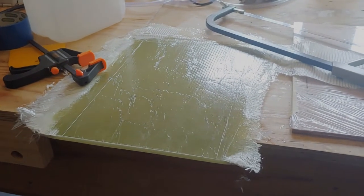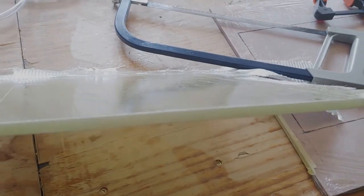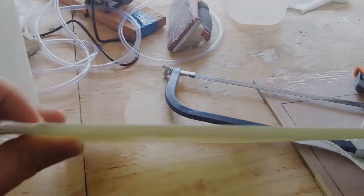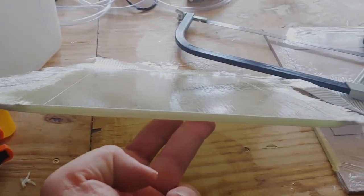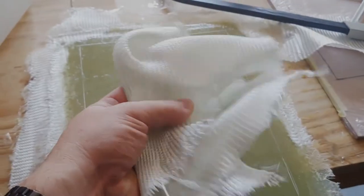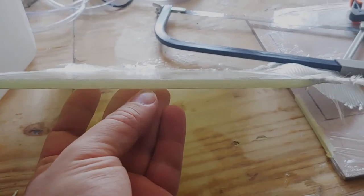So today is the next day. Last night first my power went off and then I had to work by lamplight, and then eventually my phone died while I was recording. The lighting here is not the best. These are landing gear hardpoints. I thought at the time it was a disastrous layup, but it's come out pretty well - it's come out exactly a quarter inch, which I'm happy with. Because one of the plies just wasn't aligning well and I ended up just chucking it. I wanted to do 24 plies - the plan called for 22 - and I ended up doing 23.